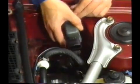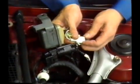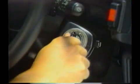To check into this, disconnect the check connector and turn the ignition switch on. When this is done, the anti-lock warning light will begin to blink. The number of times that the warning light comes on will give you the code number. Let us now observe an actual lamp blinking pattern. This lamp is blinking at regular intervals. This indicates that everything is normal.